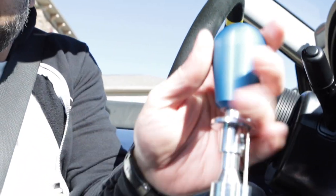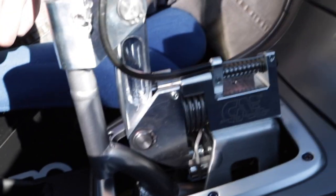And a pitch stop for the Subaru because the CAE is all wobbly when you're hard accelerating or hard decelerating. Because the cage of the CAE bolts to the chassis of the vehicle, if the driveline moves independently of the body, it sort of misaligns the shifter and you miss downshifts and sometimes miss upshifts depending on how aggressive you're driving.